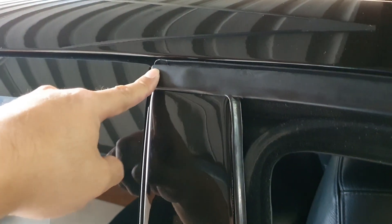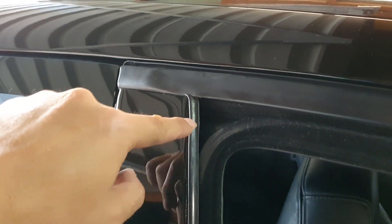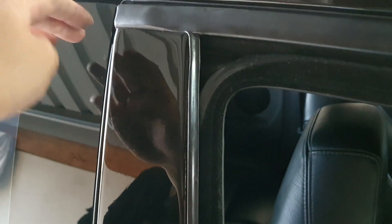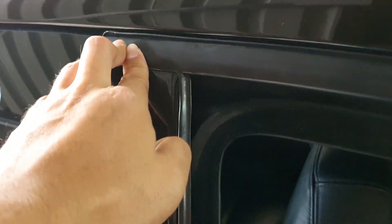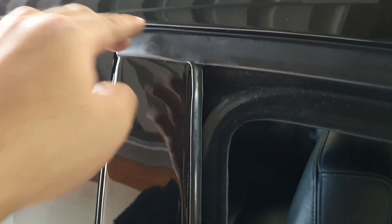The side pillar trim is looking brand new — look at that! It's almost as shiny as this glass. It's pretty crazy how much of a difference it makes. Here's a tip: put in the top seal before you actually screw in the side pillar trim. Put that in first, then put the trim in — you can actually pull out this whole entire seal with the trim in place. Put that in first because otherwise it's going to be almost impossible to get this part of the seal in, since it bulges out and it's really hard to get it all in.